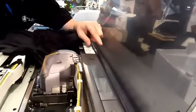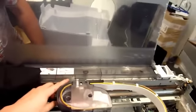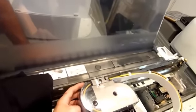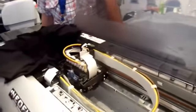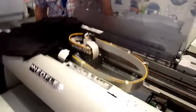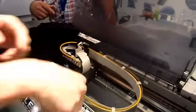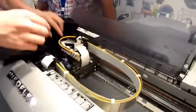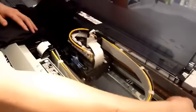What you're going to do is pull it down, twist, and pull up — so it's out of the groove. Now get this one out too. Keep the screws with the piece so you know exactly where they go. This is the side panel. Now there's a belt and it's attached to the printhead — this is what moves the printhead. What I do is I hold this and kind of pull it out while moving this towards it, and it's a lot easier to take it out.